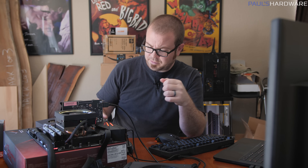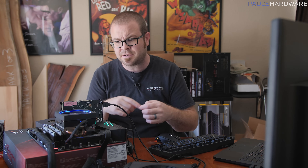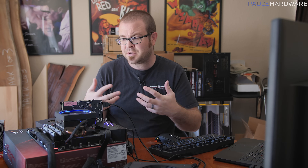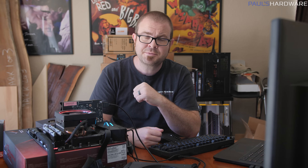I hope you've learned a little from this video, or at least watched me struggle through updating a lot of motherboards — more time consuming than I anticipated, but other than the one I broke, pretty much all were successful. One final note: there are people who report post-update issues like XMP values resetting or needing to clear the CMOS. I can't speak to that since I've only been doing basic setup to confirm the update took place, so if you're having further problems, share your experience in the comments below. Thanks so much for watching — hit the thumbs up if you enjoyed it, and we'll see you next time.